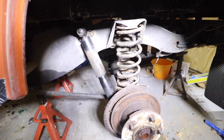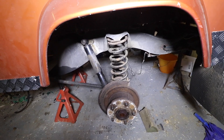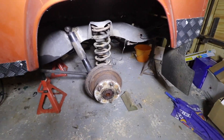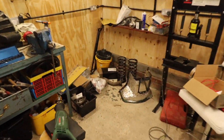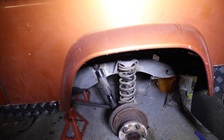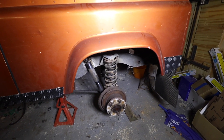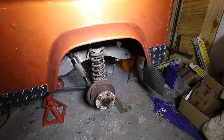I'm going to give the springs and shocks a bit of a refurb and then sell them on. They're obviously getting replaced with the Progressive Springs from Springcore Limited and the Bilsteins. The axle's going to be fully rebuilt with the differential on the floor down there, which is a limited slip Ashcroft version, and then it's going to get heavy duty Raptor shafts, new bearings, and new seals all around.